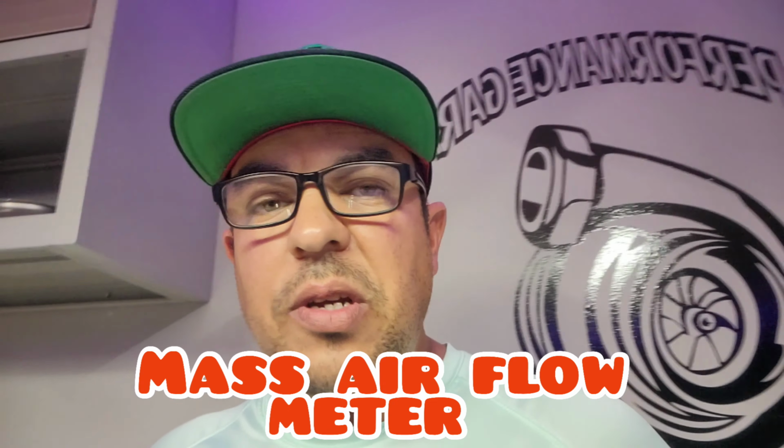Hey, what's up, guys? Welcome to the Gaza Performance Garage. Yes, this is Mr. Gaza here with some very important tech information on your 2JZ-GE motor for turbocharging. All right, first of all, you never throw away your stock MAF sensor. This is paired to your car and it sends the signals that communicate with the computer on injector fire and also transmission shifting. All right, so what we're gonna do is keep that.